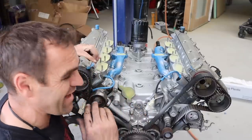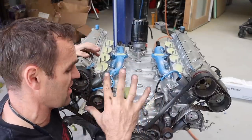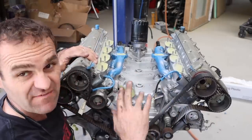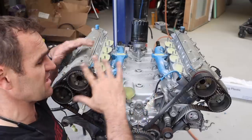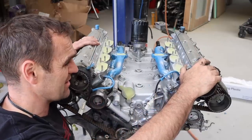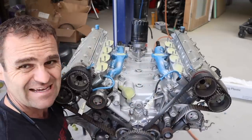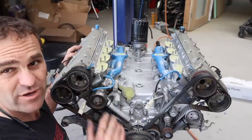I'm quite happy with that — just a light dusting over the whole thing, freshens it up and makes it look neat and crisp without going overboard. I wasn't worried about the belts since I've got replacements. Now I'm going to take the rocker covers off because these are going to get painted thoroughly. I'll cover the engine up and wrap it so it doesn't get any contaminants while it sits exposed, and we'll start working on the rocker covers.